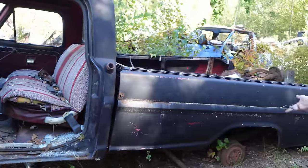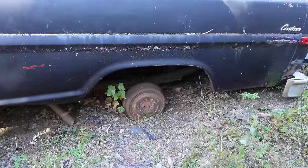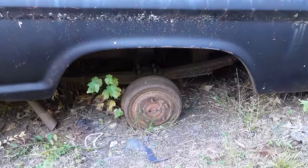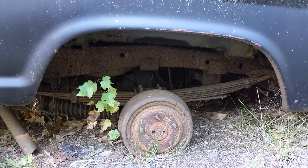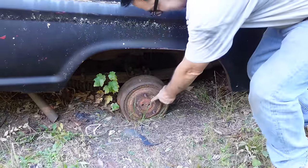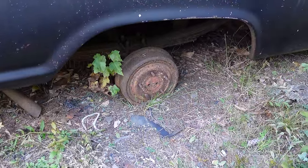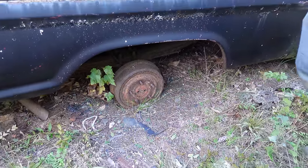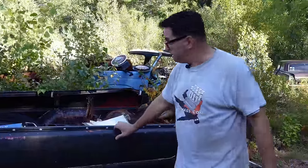Is it still here? Well, here's the end of that 9-inch axle right there. And if that's the original axle, this thing has a 3.50 Traction-Lok locking differential. That's about an $800 center section right there, assuming it's still here. Now, signs of orange paint on the end tell us that Johnny Hot Rodder might have owned this thing at some point, and maybe somebody's been in there and either robbed that, or who can say. But the H2, 3.50 Traction-Lok differential, kind of cool.